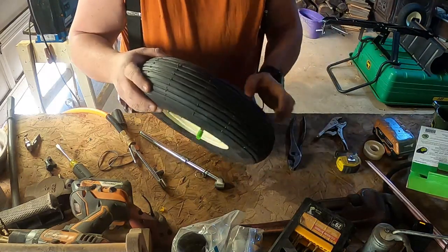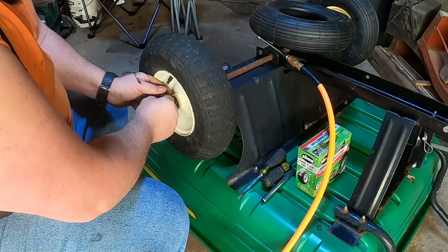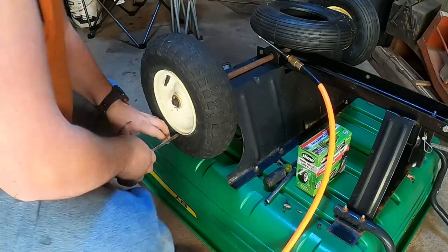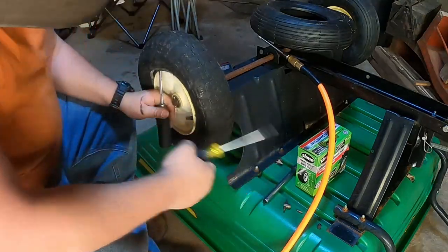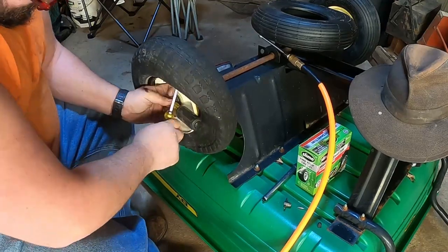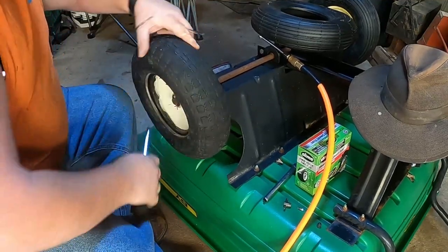Now I'm going to move on to doing it on the trailer. As always, make sure all the air is out of the tire you're working on - you don't want any unexpected injuries or mishaps. Cannot stress that enough. What I'm doing here is pulling the valve stem out, which will pretty much guarantee that the air is out. Just like doing it on a workbench except it does make it a little harder on yourself because it's constantly moving.